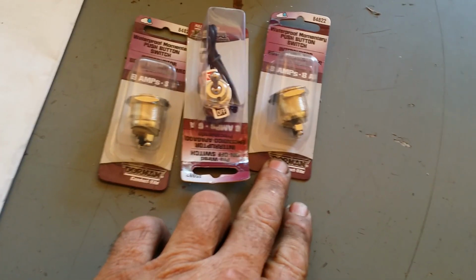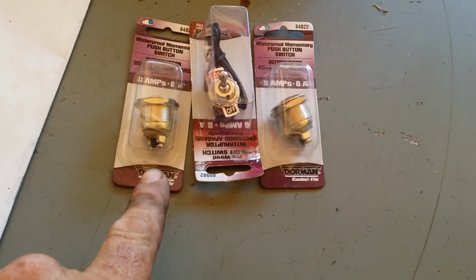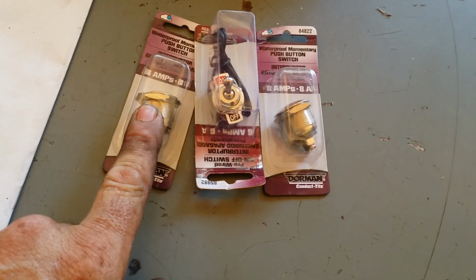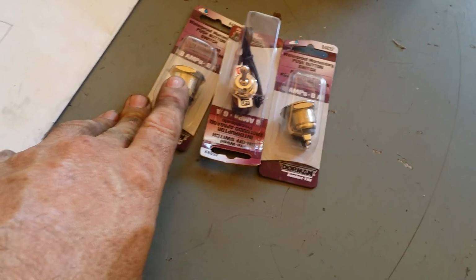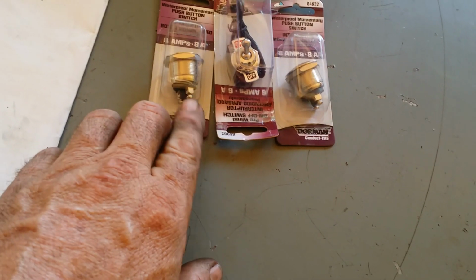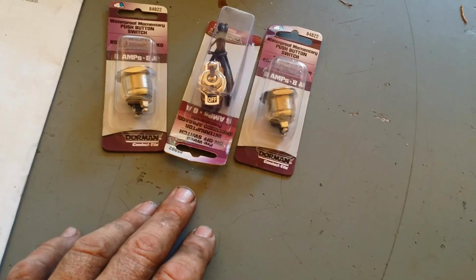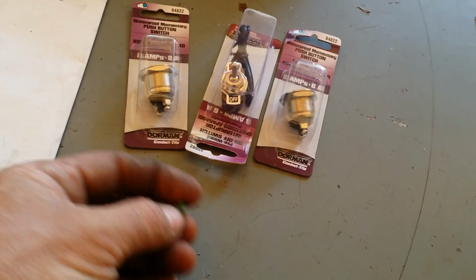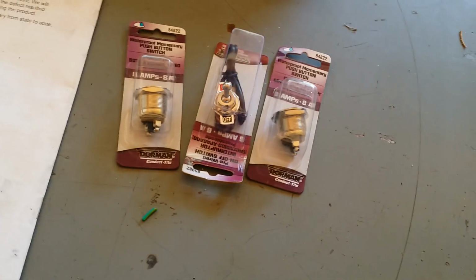But when you power up a coil like that, a contact, there's a coil inside there that pulls that contactor in and either way, reverse or forward. When you let go of that button, that coil is going to send voltage back up that wire into this switch. And it's going to be like an AC voltage, kind of like an ignition coil, just a little bit, but it will bite you. So what you got to do is put a diode in here. I know this is kind of crazy for a lot of people to do, but you can do it. If you ask me, I'll help you guys with this stuff, but you got to put a diode in here to keep the flyback current from that coil inside that contactor from sending voltage back up the wire and biting you. It may be fun to get one of your buddies to push it, but we don't want to be doing that.